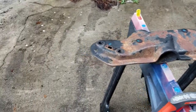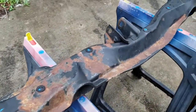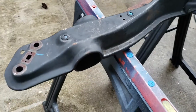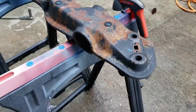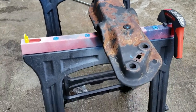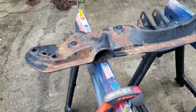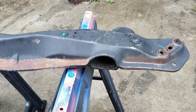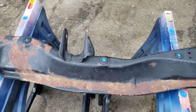We're still at the EF, the ED6 hatch. The gas tank was rusted — got that thing capped off. We had the original cross member for the front; it was in pretty bad shape. My nephew washed it up and cleaned it off with the pressure washer. We're going to hit it with a couple coats of Rust-Oleum rust stopper primer and then paint it enamel black and get it back in the car. We found the passenger-side wheel was locked up, so we want to stabilize the front of the car — these unibodies don't like to be jacked up with the cross members disconnected; they like to twist. We're going to get this sprayed up and hopefully get some Energy Suspension polyurethane pucks in there. We'll get the engine mounted to this front mounting point so we can get it lowered.